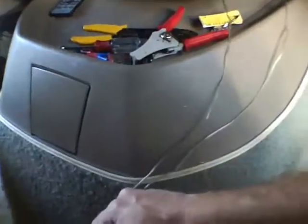Underneath the doghouse, right about here, there's a heat shield. I punched a couple of holes in it, cut another piece of sheet metal, bent it over a little bit to make an extra heat shield, and did the same thing back here. I heard a lot of people complaining about the passenger seat — the heat just bleeding through. There's insulation on the inside of the doghouse already, but a little extra piece of sheet metal ain't gonna hurt. I did the same on the driver's side to help get the air to flow in the doghouse so it doesn't soak in and make the cab all hot.